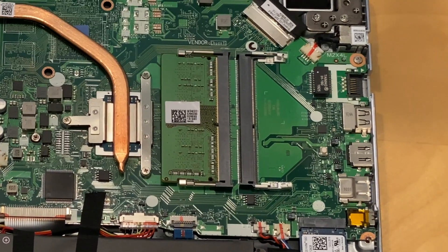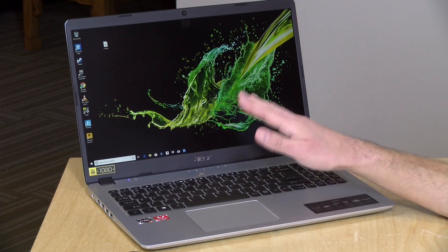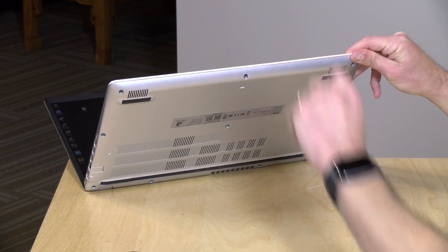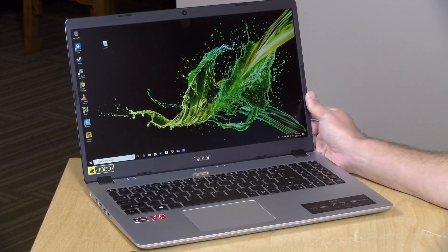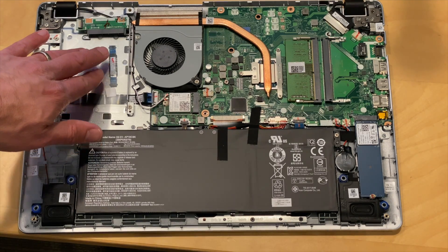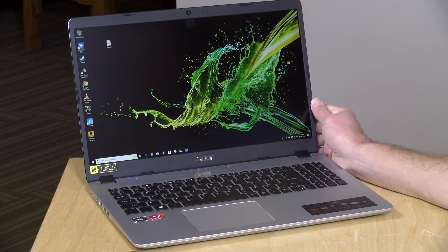My recommendation is to buy a second stick of RAM or just get a new set. We brought ours up to 8 gigabytes — two sticks of four — for this review. When you have the RAM in dual-channel configuration, it runs a lot faster, especially for games and graphically-intensive tasks. Getting inside is not hard; you just unscrew the screws on the bottom and pop the lid off. We took it apart earlier on the Extras channel if you want to see that.